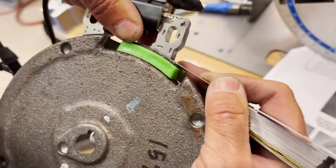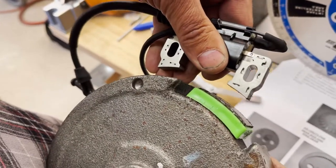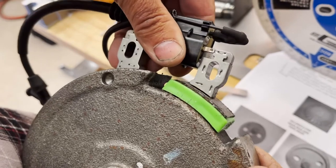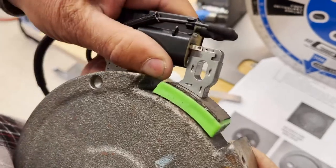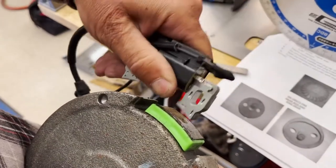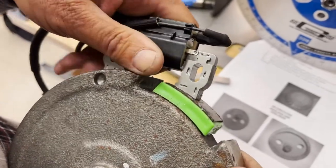Right, that's huge. Okay, so now, if the coil's here, the engine is retarded. The spark timing is retarded. If the coil is closer to this magnet, it advances the spark timing and makes the car faster. So the closer it is, the faster the car. Correct.